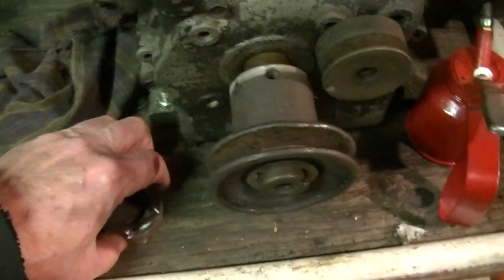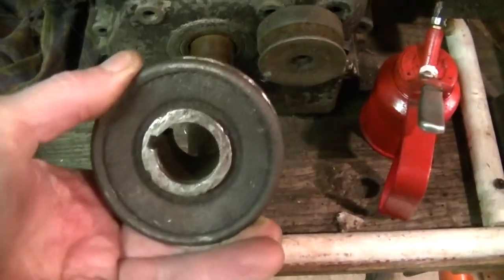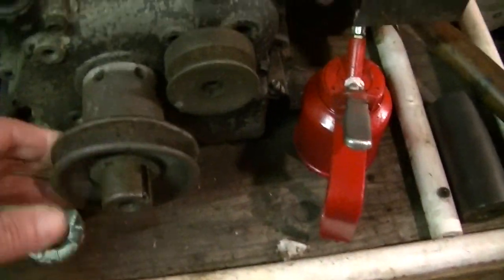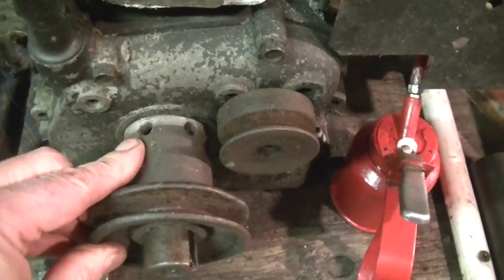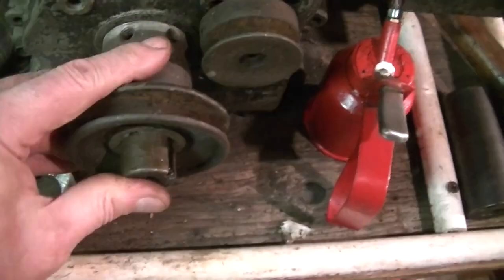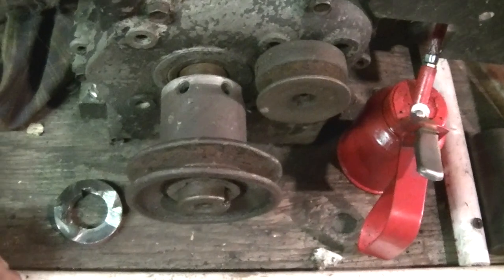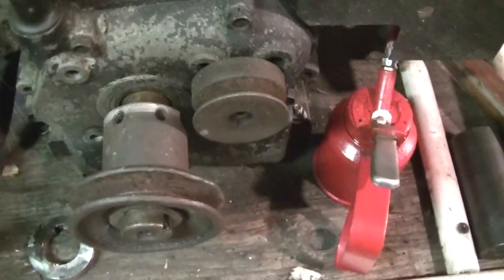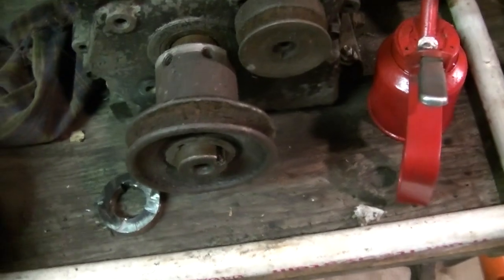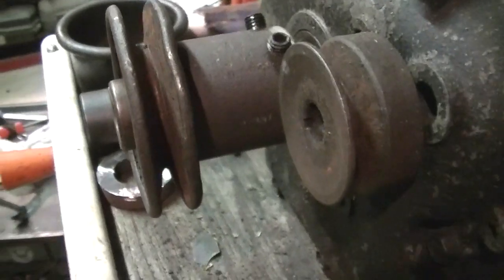Okay, we cut this much off of the pulley with the cutting wheel. Then we had to file out a little bit to make the ends a little more open. And we still have a place for our Allens. And this is about how far in, actually right about here was about where the other one was. Maybe about there. So we got a lot of room to play with if this is going to go on that Snapper snowblower. Yeah, I got the Allens in. Still working on the shape of this. Still a little.